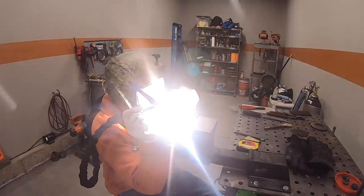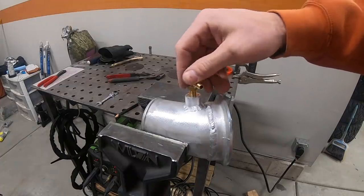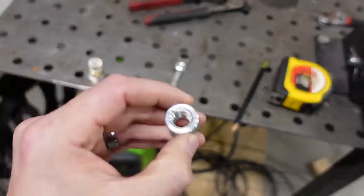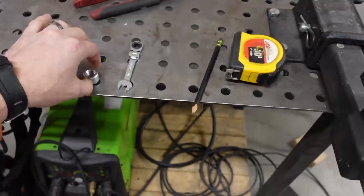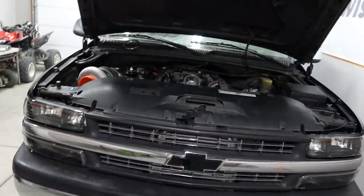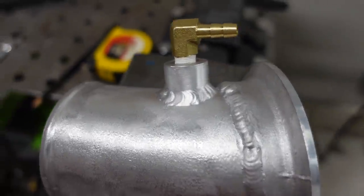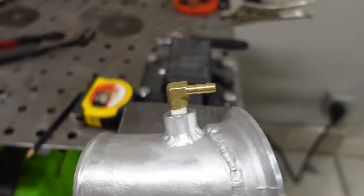It is made from aluminum and you could drill and tap directly into it, but it's a little bit thin in my opinion for tapping. So it's just more peace of mind to weld on a 1/8-inch NPT bung. I always keep a couple of these on hand — they're pretty simple and inexpensive, like $5 or $7 each. This one is 1/4-inch NPT with a nice little step on the end; this other one is 3/8-inch NPT for the inlet air temp sensor I'm going to be running in the driver's side charge pipe. I'll cherry pick and show you the best spot of the weld, but I'm kind of proud of it — it looks a lot better than my previous attempt, so we're getting a little bit better. I did install a 90-degree elbow to go to a 1/4-inch hose barb.